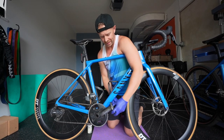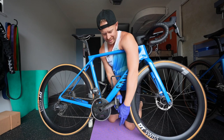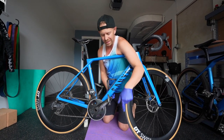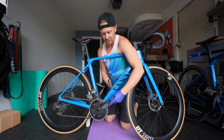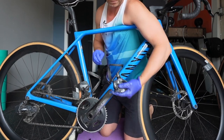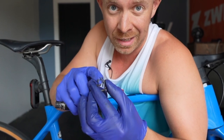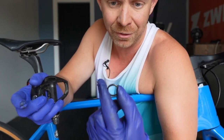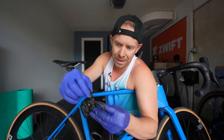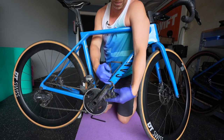It might not be a terrible idea to have some gloves around as you're working on a bike, because let's face it, a bike is a little bit greasy. What a lot of new cyclists do with their pedals when they put them on is they'll just put them on, tighten them up, and then in the course of turning the pedals, they'll tighten up a lot and the pedal axle might fuse to the edge of the crank arm. To prevent that from happening, there are two things you should do. Number one, there's a pedal washer that will come with most pedals. If you lose this, go to a local bike shop and get it replaced — they'll typically give it to you because they'll have them lying around. It's about an eighth of an inch thick and it just goes on top of the axle of the pedal, in between the edge of the axle and the edge of the crank arm, to make sure you've got a little bit of play so nothing fuses.